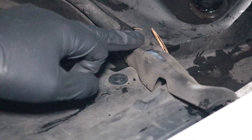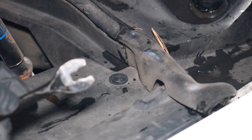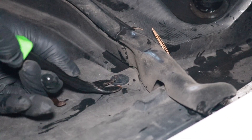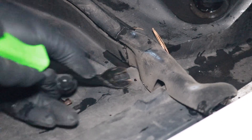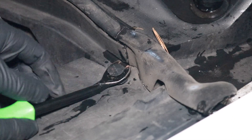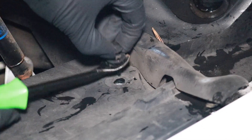While we're on the driver's side, just beneath that rubber seal, you'll notice there's one of four push pins that we need to remove. The easiest way is with a body clip removal tool. Simply insert it between the two plastic pieces and try to pop up the top section of the clip. It may damage it a little bit — just pop up the top section, make another purchase underneath the clip, and simply pop it out.